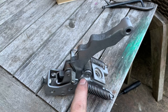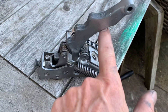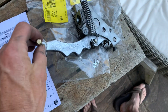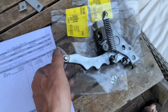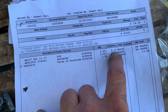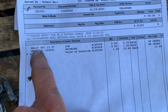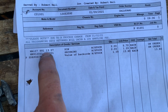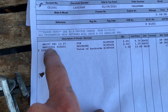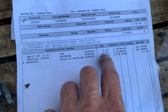Before you put this back on the car, don't forget to put grease on the runners and all the tracks here and also on the back. These door pins and clips came from Mercedes. We've got one for each side — the door pins are £5.70 plus VAT and the clips are £1.20 plus VAT. The part numbers are 107 991 1307 for the pin and 912 001 006 001 for the little clip.